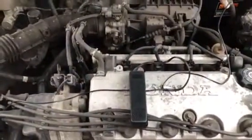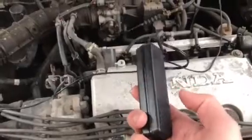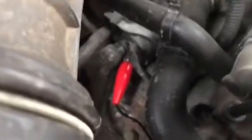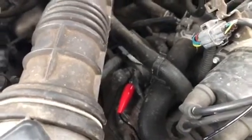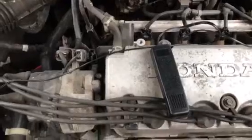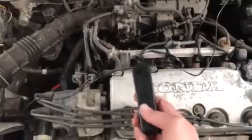We're out in the engine bay. So basically what I've got: two wires — one attached to battery positive, the next one attached to the starter motor down there on the start solenoid. It's in the key-on position, and all you do is press this together. I haven't disabled the engine so it's going to get a bit noisy — she's going to start now, excuse the noise.